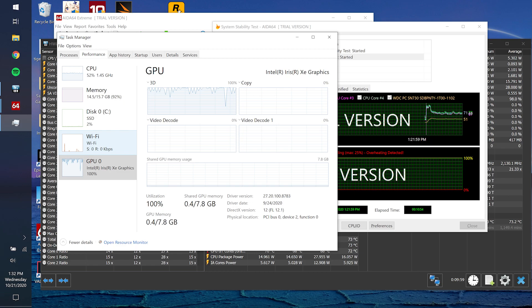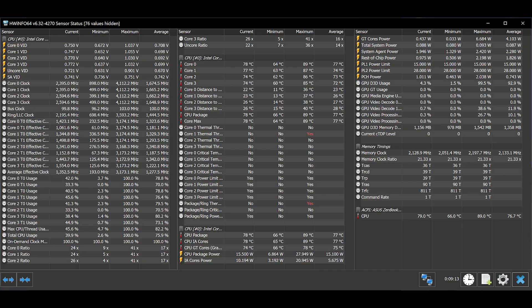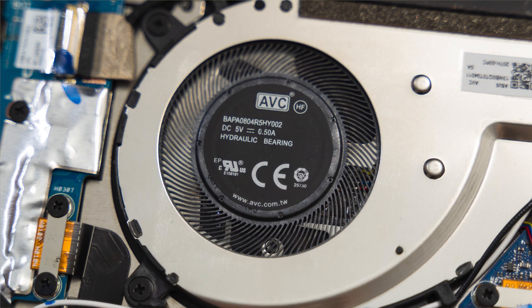Even though this chip is rated at 28W TDP, it's mostly held back by its cooling system — during stress testing it typically operates at 15W, though it can spike to 28W momentarily when the cooler can handle it. Temperatures ran hot, reaching about 82°C during gaming at highest performance settings, due to only a single heat pipe leading to a very tiny heatsink. ASUS claims a new blade fan design with thinner blades for more airflow, but oddly the intake slits are not actually cut through — so it's unclear where the airflow is going.